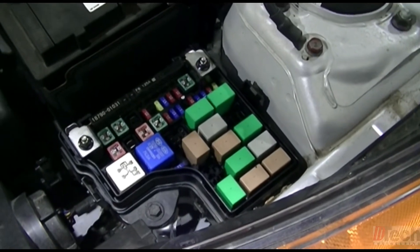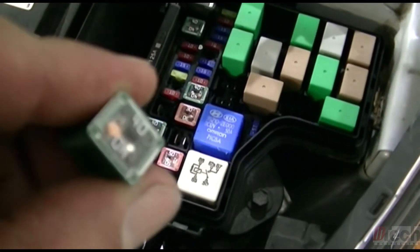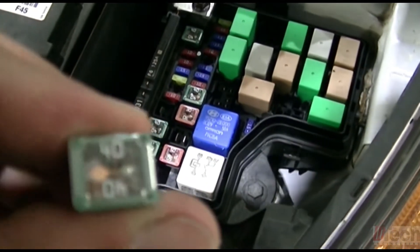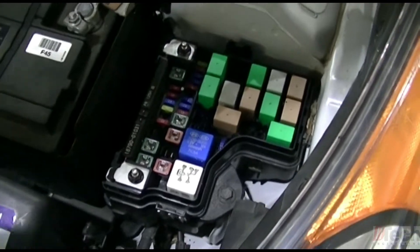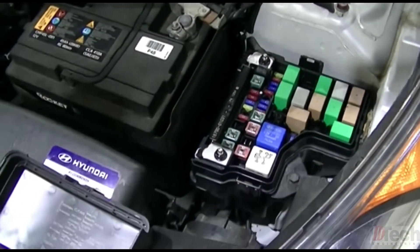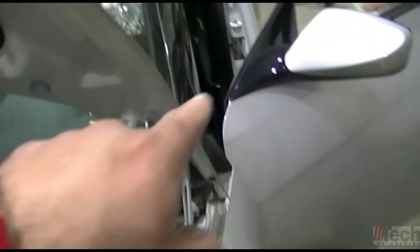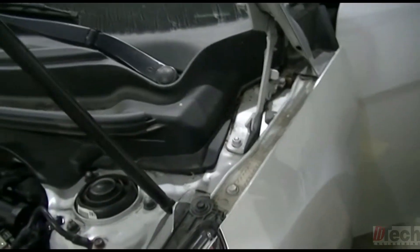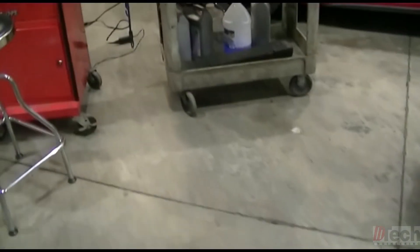Since this would be the easy one to get to under the hood, I decided to take a quick look. I can see the DCT fuse — the second one up — which I've pulled out and inspected. The fuse is good, and more importantly, the fuse is present. So I'm going to assume that's not the issue. The last thing to do is check this power supply at the connector inside. If that's good, then I think we are good to call for a bad computer.